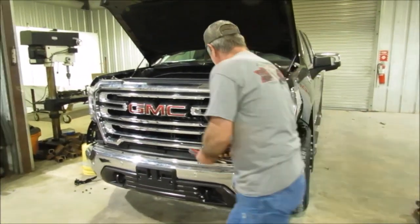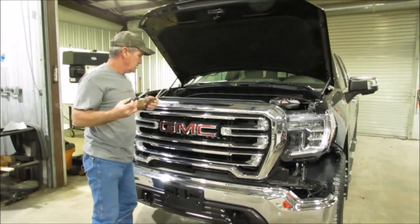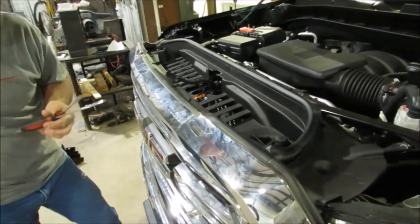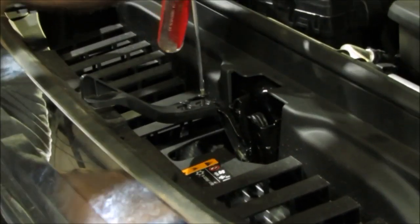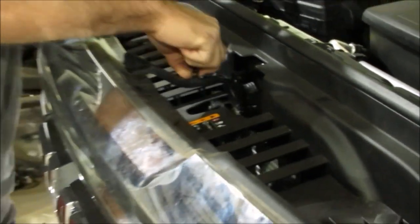is now let's just do the hood latch next. You're going to have to take this top off, because this chrome bumper's got to come off, because the bolts are up underneath that chrome bumper. There again, it's a 15 little star wrench. You got to take your hood latch off, okay? You've already kind of got them loose. There's two of them, 2 screws there.